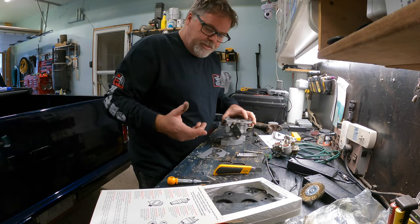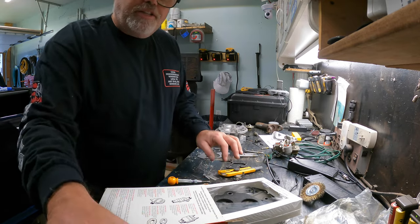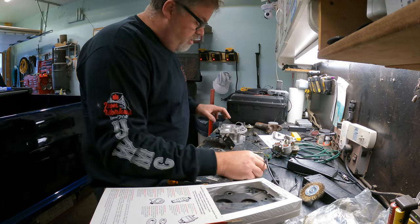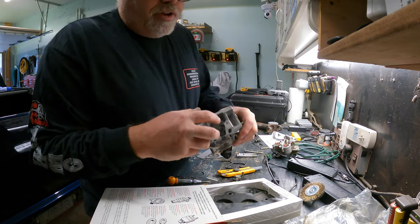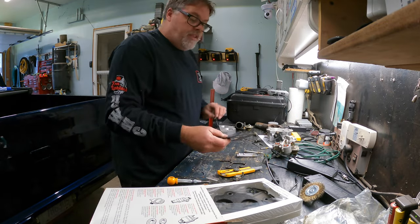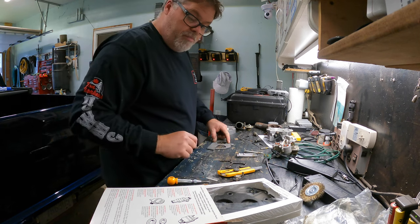What I'm doing right now is I needed a screw to hold on this thing. Steve had a couple extra throttle bodies, so I got another screw from Steve, went to put it in my new throttle body and it broke off — thread locked like that. So I drilled it out already but we still got to get an easy-out and get that out.